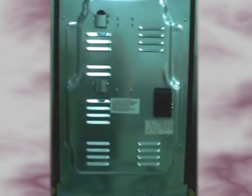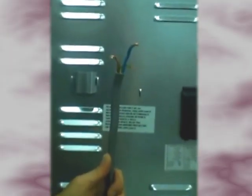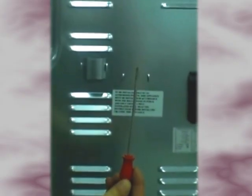To install this appliance, you will need the following: a 6mm² cooker cable — this needs to be long enough to fit to the cooker and to the cooker point when the appliance is in its final position — a flathead screwdriver, and a crosshead screwdriver. Now you must make sure the power supply is turned off. It is important that you fully understand that this appliance must be earthed.